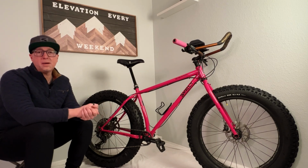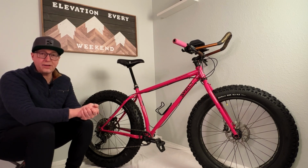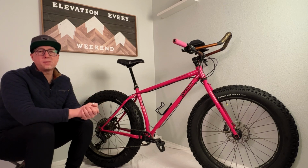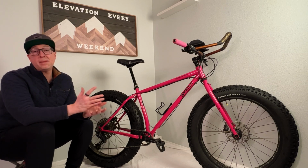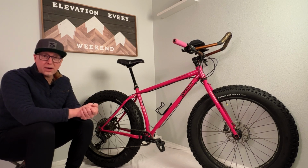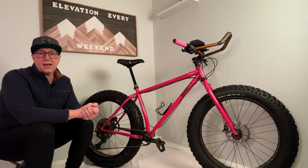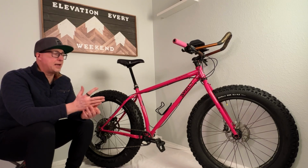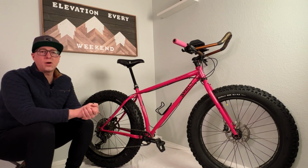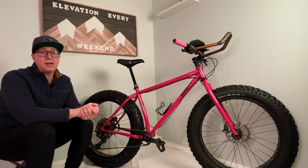So on the whole, I've been quite pleased with this tire combination from the standpoint of puncture resistance and durability and traction when aired down. I do really wish that the sidewalls on the rear Lou would have been a little more substantial to match the tread life of the tire and maybe even get another year out of it. As to whether I would recommend these or not, I would give a strong recommend to the front tire. I would probably lean more toward a weaker recommend on the rear tire, and that's not really because it's been bad in and of itself, but it is a little disappointing that the casing's not living up to the tread life and it's not matching more closely to the front tire as far as overall performance and reliability. So these do need to be replaced, and even though I did like these, I'm not going to put the same tires back on this bike.